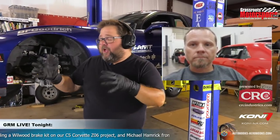Okay, good. So we have a couple questions, and I have this information written down here. Folks are asking about just specific specs of the rotors, weights, and measures. Weight-wise, I actually went through and weighed everything on our fancy Intercomp scales. Total weight of the system is actually nearly identical to the system that came off. So we're not gaining any lightness, but we are gaining a ton of leverage, and we're gaining a lot of heat shedding capacity. So while we always preach, lighten where you can, sometimes we have to use a little bit of this mass to actually get rid of some of that heat.